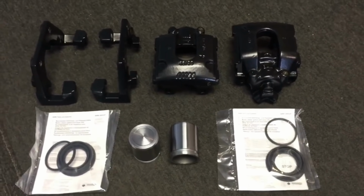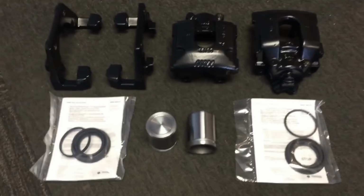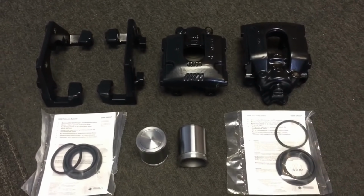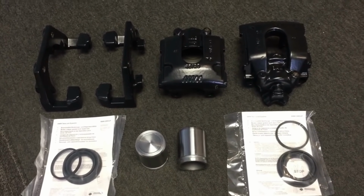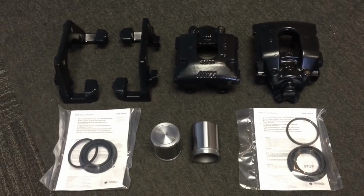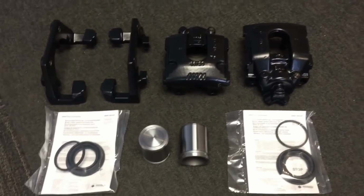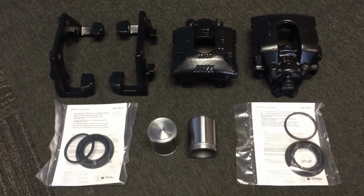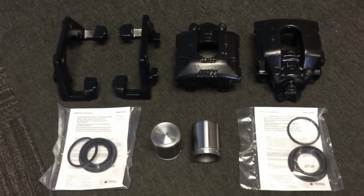This is the CSL rear brake caliper rebuild for the CSL restoration that we're doing. We've had the original CSL calipers media blasted and masked inside the piston housings, so there's no chance of any grit or paint getting in there. Then they've been powder primed, powder colour applied, and also wet lacquered, all satin finished to try and replicate the original BMW finishes.